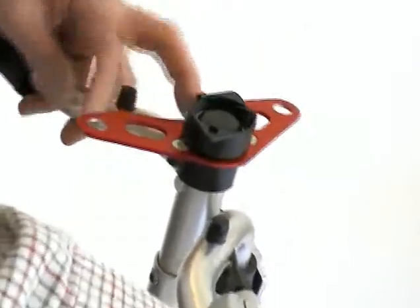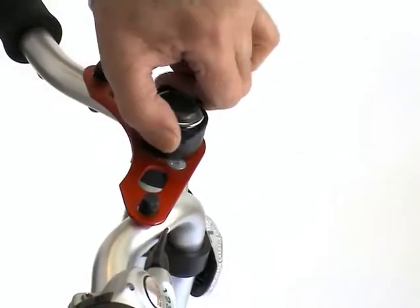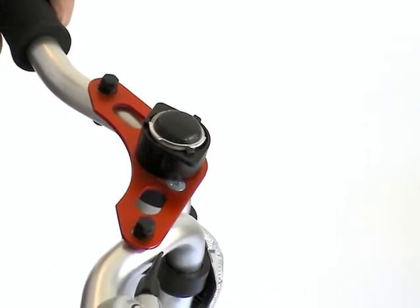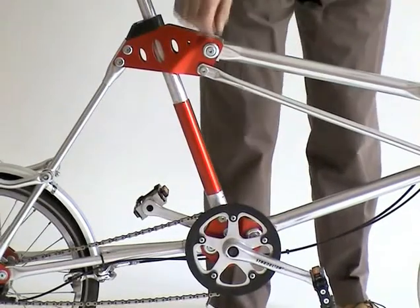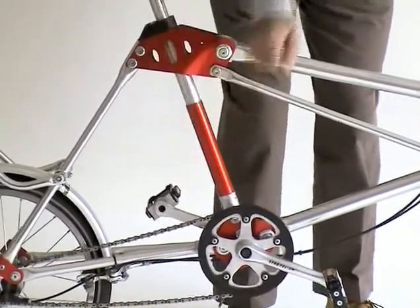When on, push the plate down to see that it is properly seated, and then you should turn the winged plastic lock to the left so that the wings are parallel to the handlebars. Finally, check that the sleeve on the saddle column is fully down over the hinge.